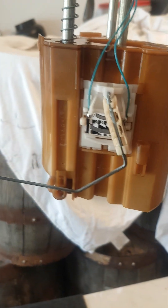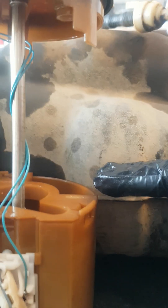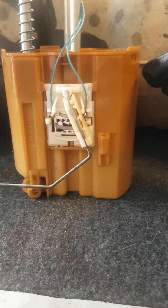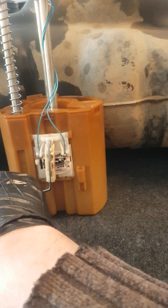What I can't work out is where does the rest of the fuel get into this unit, because there's no holes in the bottom, there's no holes in the sides — all that there is is this little thing here which has a blank on it. Logically, what's happening is when the tank is more than half full the fuel sits at this level and just pours into the unit, but once it gets below this level all that's left is what's circulating back in — which is obviously giving us that halfway reading because the fuel will be sitting up here but there's actually no fuel getting into this unit.